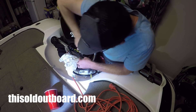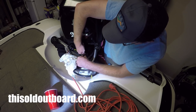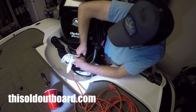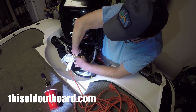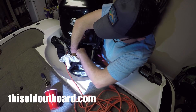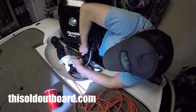Opening it up — it may spurt a bit. You start seeing fluid — it is fluid. We don't want to lose a lot of fluid, but we got the air out, that's the good part. We had a steady stream so we closed it finger tight, now closing it good and tight. Don't put too much muscle on it or you'll strip the threads, but get it good and tight.